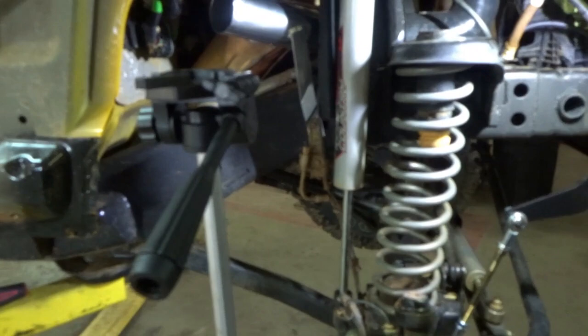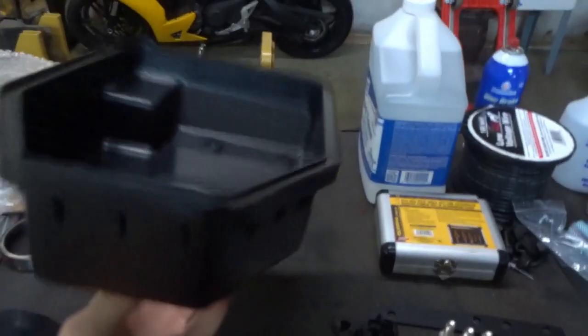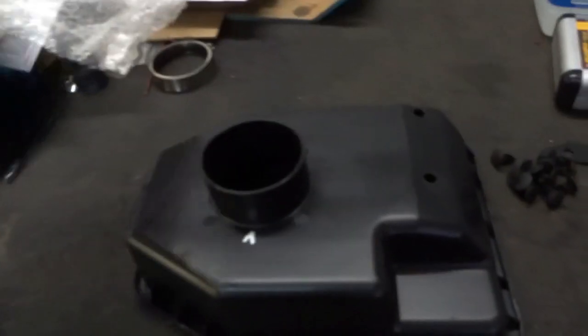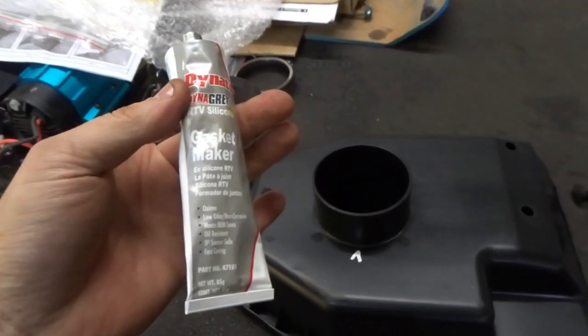Your new bottom part of your air box — there's the old one. Remember the aluminum tube under or next to the motor: after you install it, you're going to want to put the bottom piece on your tube and mark it just like I did, so you know which way it goes and it ain't turned one way or the other. You're going to line those up, put gasket maker silicone around this, put your tube on, clamp it down, and then come from the inside where the tube comes on and wipe silicone right there.